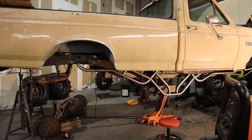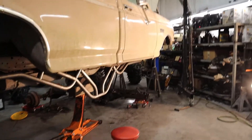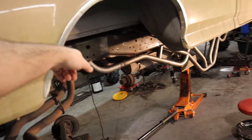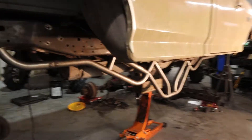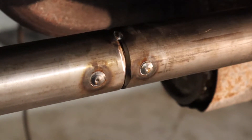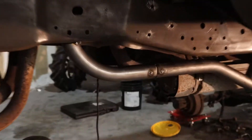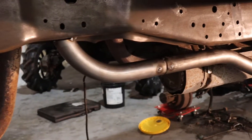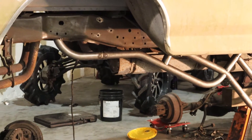It was my original design — well, the center part was. We did have one mess-up on the splice, but everything else was done first shot. We were three inches too short. The original plan was to come straight and die in, but as you can see where it's bent, that would never have worked to tie into the shock mount. If you're doing a roll cage, you need to do it on a 45-degree angle.